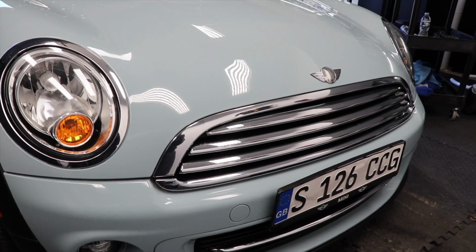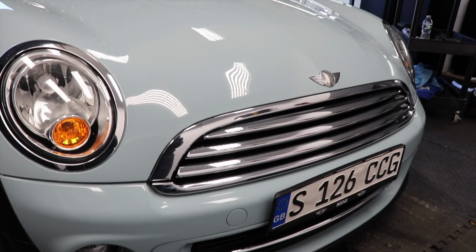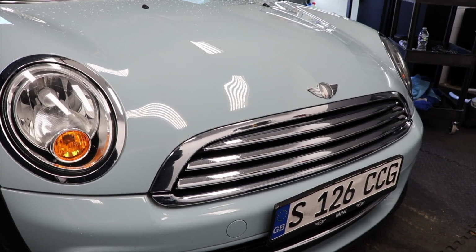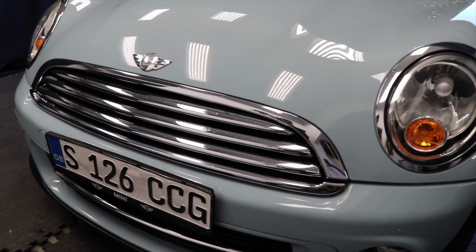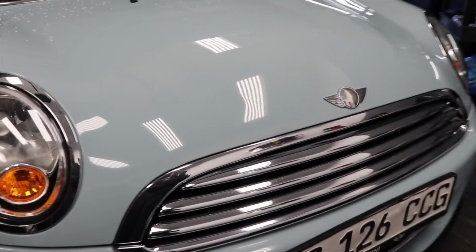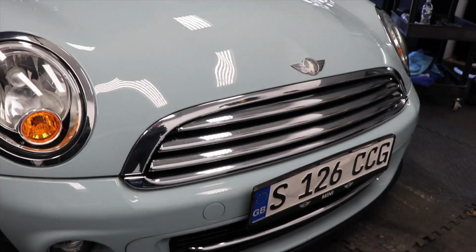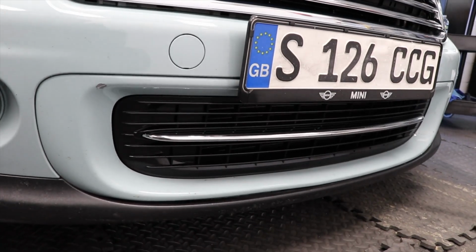And the other thing to note here is when you've got that shiny background and it contrasts that freckling appearance, it actually becomes a lot more obvious that the freckling is damaged, even to the customer, because the chrome itself looks so great and so shiny and so protected that the damage becomes really obviously damaged. It doesn't look like dirt, whereas when it's sitting against a matte background, it actually looks very dirty. And when you've got that dirty, non-uniform appearance, it kind of looks like you went a little too quick.